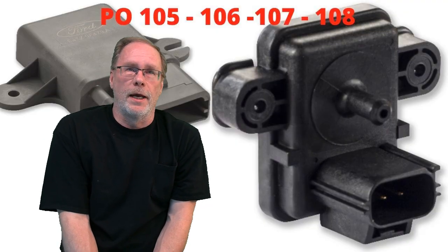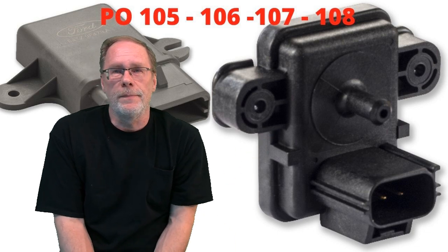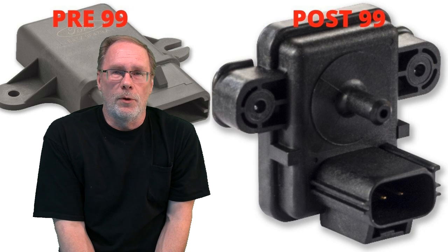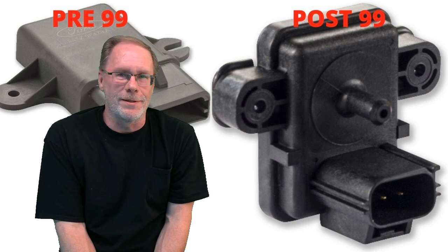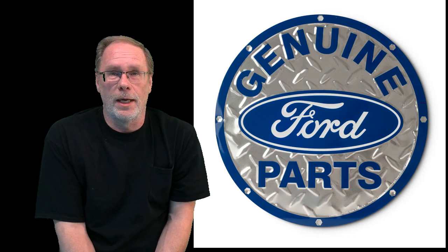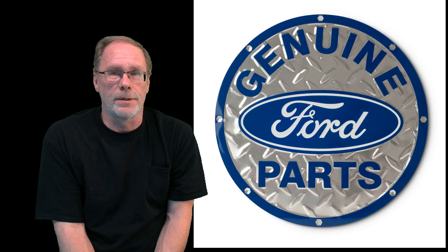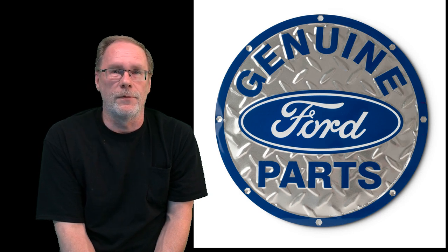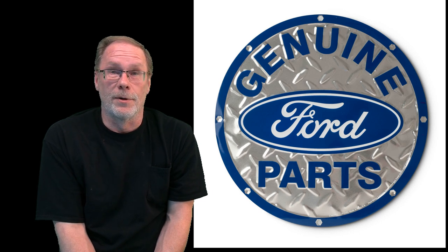The 94 through 98 and the 99 through 03 use different sensors. They're on the screen. And these need to be quality. Don't be running out to eBay or Amazon and getting some junk. Let's spend the money once and get a good Ford OEM quality MAP sensor installed, because the other ones are going to be cheaper. Yeah, you're going to save a few bucks, and then a couple of years down the line, you're going to be replacing it again or sitting on the side of the road, and we all know how fun that is.